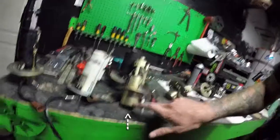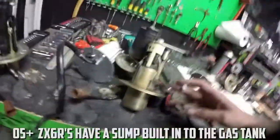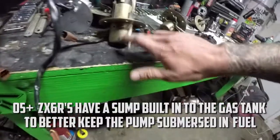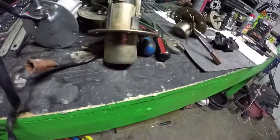After a little bit of riding with the 2013 pump, I noticed that on stoppies and when I was low on fuel it would kind of bog out and not run right. I noticed that the 2003 has a sump on it, while this one is flat.